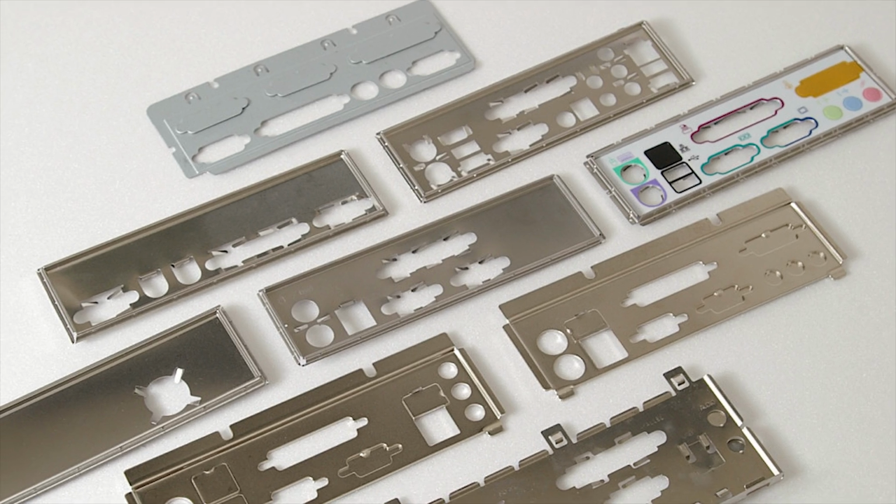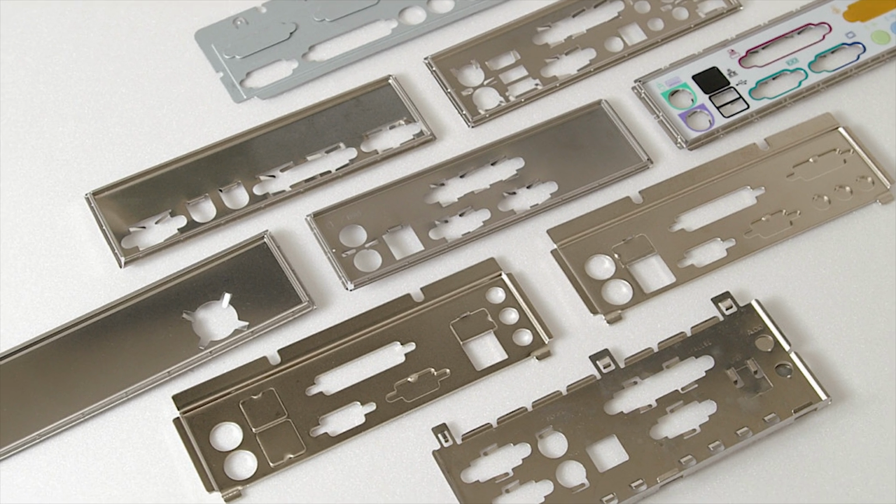Here are some things that I found oddly difficult when building my PC. First of all, the motherboard is so hard to put in right with the I/O shield. I tried putting the I/O shield in first and then the motherboard, and then I tried putting the I/O shield onto the motherboard first and putting it all inside at once. But then I went back to the traditional method again, and honestly, it was pretty difficult because there were some metal prongs on the I/O shield that are supposed to bend in when you put in the motherboard. But the prongs are super stiff on my motherboard, and it was really a pain, and it took about 15 minutes for such a simple task.